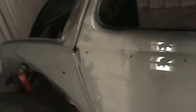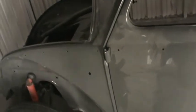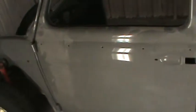If he wants to take it somewhere and have a hinge pin put in, he can do that. He's got the pins. He can rent the tool and do it himself. And then I can repaint whatever damage they do, because it will damage the door, I'm afraid. And at least mark the hinge up. The hinge will have to be repainted. The problem with trying to do it with an air hammer here is your air hammer is right on the door and you have no room for air. So that's where we're at. We're just gonna go ahead and finish this one up.